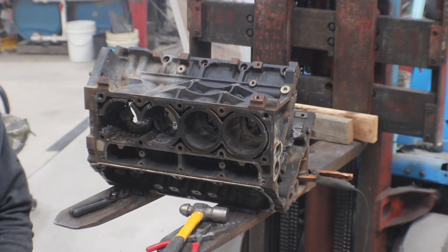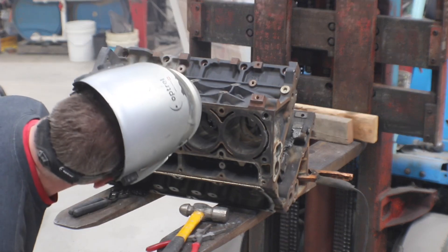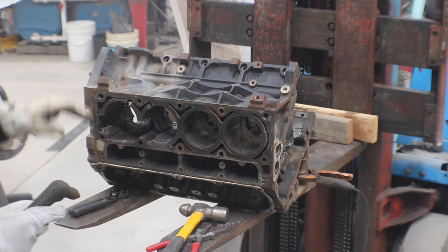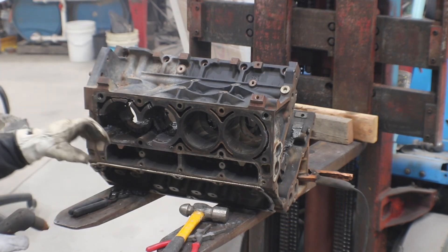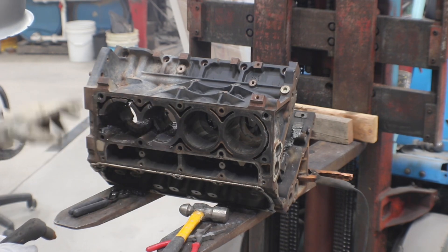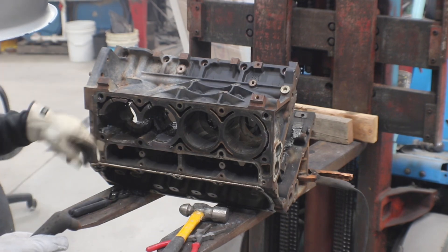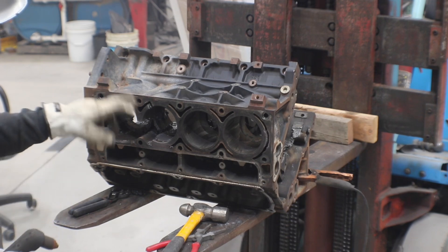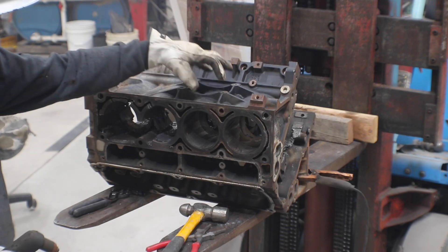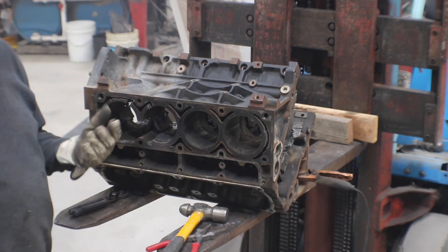This block has gotten very hot. These cylinders are like ovens. I'm using a thicker glove and just trying to break out pieces of the cylinders. At the bottom you've got water jackets around the cylinder and up into the head, but through the bottom you don't, so the casting is a lot thicker there. Just trying to get a few pieces out here and there, trying to leave enough metal to support this area — maybe ruining the whole thing and spending hours playing at it, but... science!